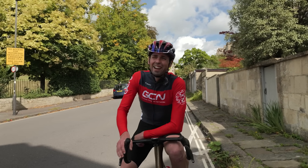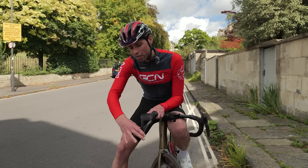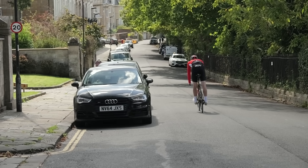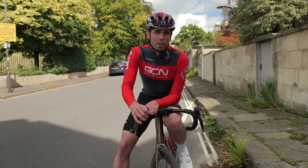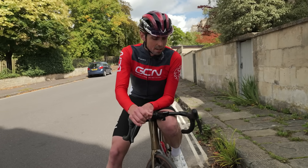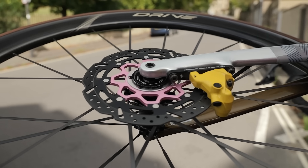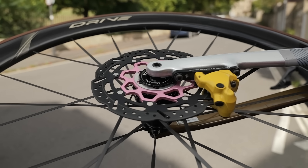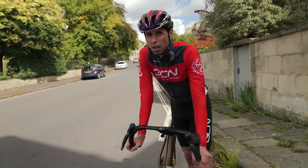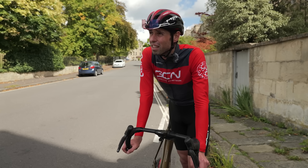Number three. I'm trying to think about how I can portray this. If you've got used to riding any bike, you get used to the brake performance — you know roughly what it translates to in terms of the pressure you put on the brake lever. I've got a good relationship with this bike; I know exactly what it feels like to ride. Right now I'm having to pull the front brake very, very hard compared to what I normally do, which is counter-intuitive given resin pads normally have a real good initial bite. You can really see a lot of shiny silver, which is very disappointing. I'm not really sure what I was ever expecting buying a set of rotors off AliExpress. I'm going to say AliExpress knock-off budget carbon ceramic rotors — it's a no for me. I don't think I need to go up and down the hill anymore to prove my point.